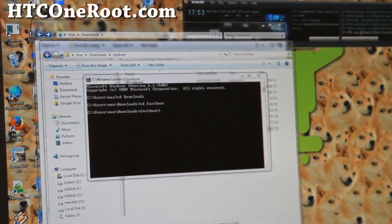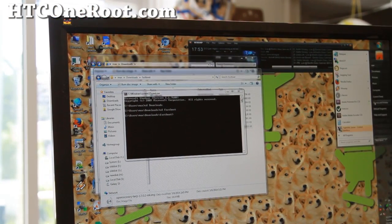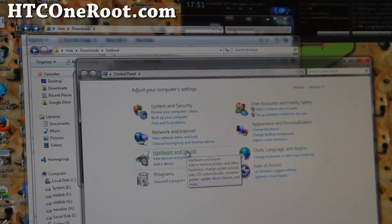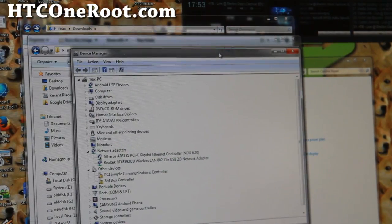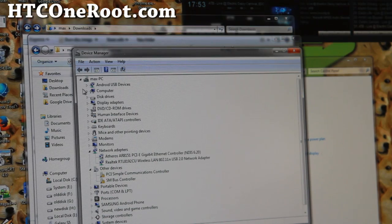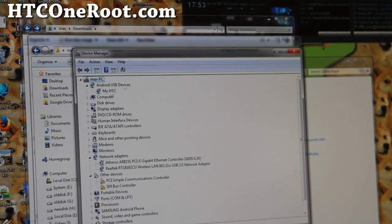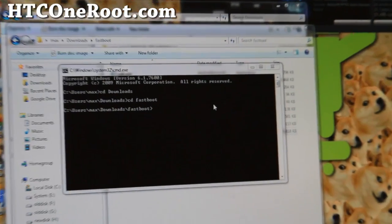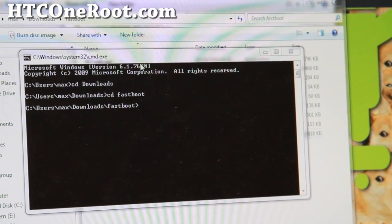Before continuing — if you're on Linux or Mac you don't need to worry about drivers. But if you're on Windows (I'm using Windows 7 64-bit), go to Hardware and Sound > Device Manager. You should see something like 'My HTC' or an Android USB device. If you don't, download the HTC drivers for Windows from my site, run the .exe file, and you may need to reboot your computer and repeat all the steps. Once you have that done, you're ready to go.